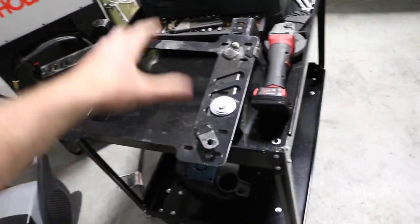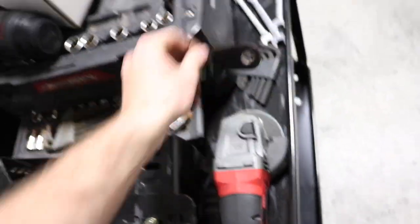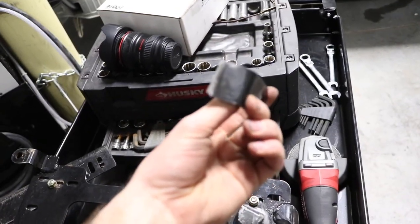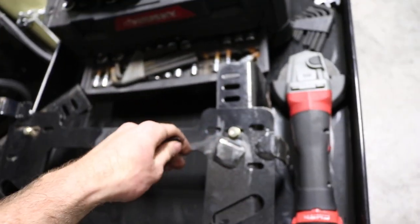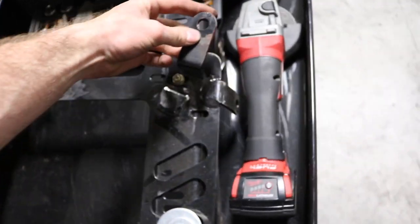These eBay seat brackets have been giving me grief the entire time I've had them. This arm right here, this little leg of it, even broke off. I don't even know how — it was just the welds that snapped. Kind of got it grinded down so I can get to the bare metal. I'm going to go ahead and weld that back on there.